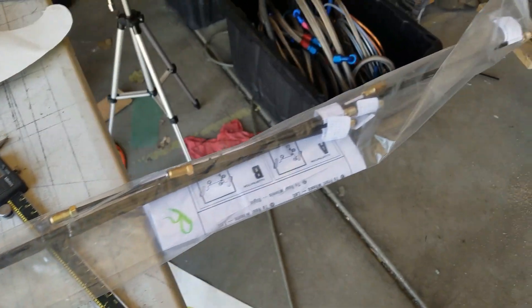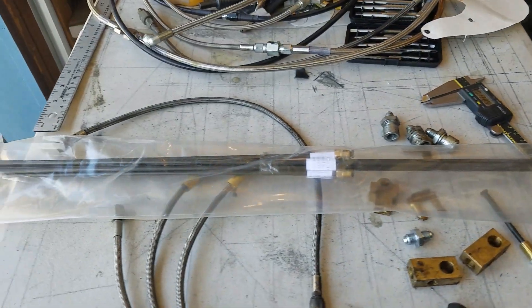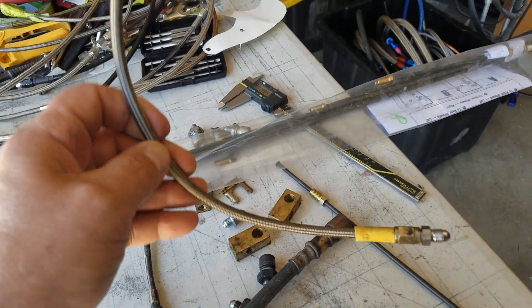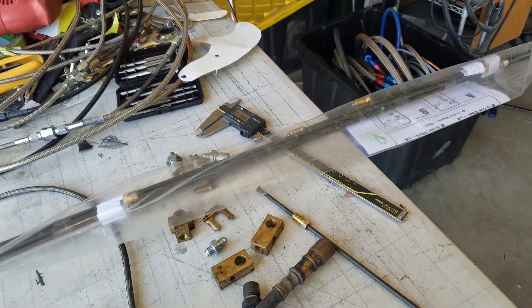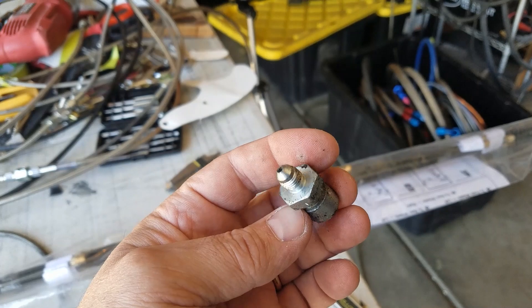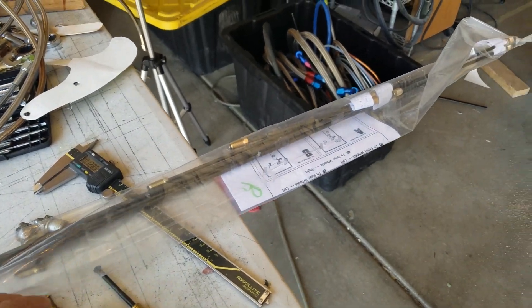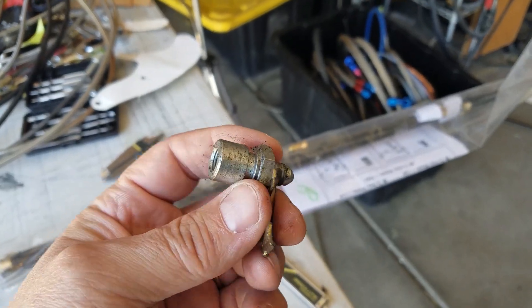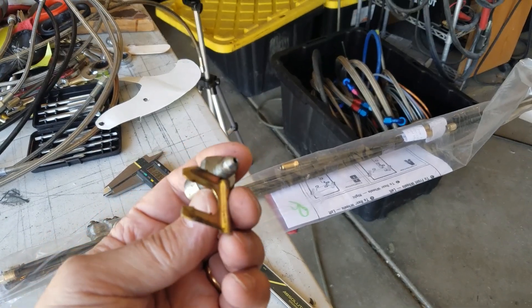Some of the other bits we're going to need is basically a brake line kit. This is just a generic brake line kit for front and rear brakes. It's all steel that is coated so that it doesn't corrode. We will need some flexible ends that will go onto the brake caliper, because the suspension moves up and down. And then we will also need these guys to go from the dash 3 AN fittings to the inverted flare of the brake lines. In addition we'll need some mounts — those are incoming so I've ordered those. They're weld-on mounts so we'll be able to weld those on so you can put the line in and then clip it in.